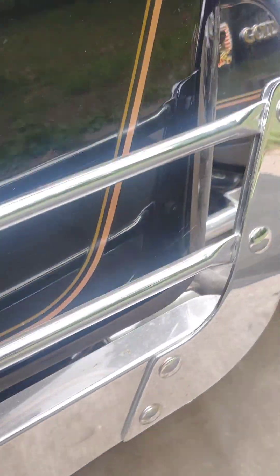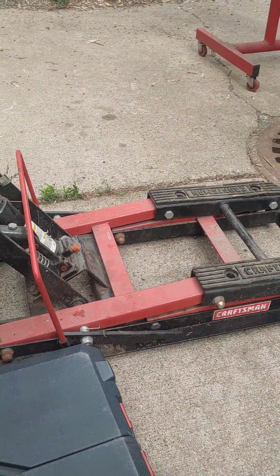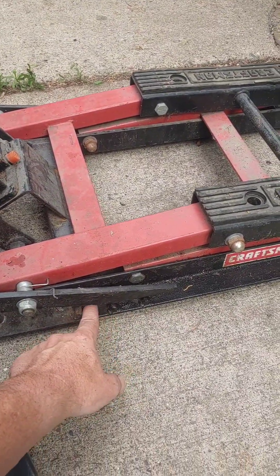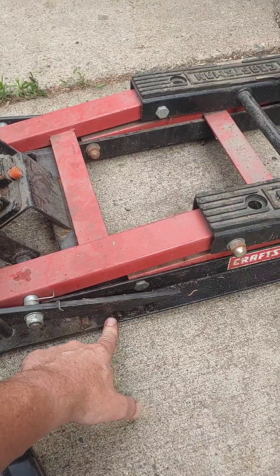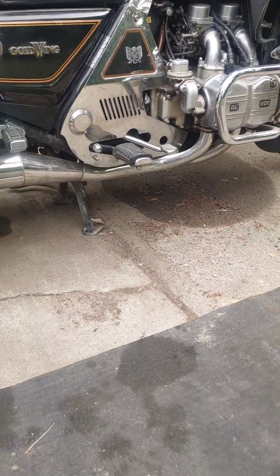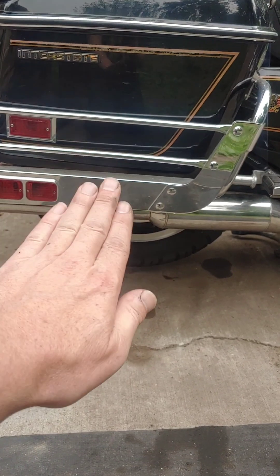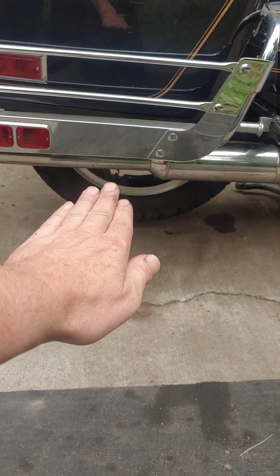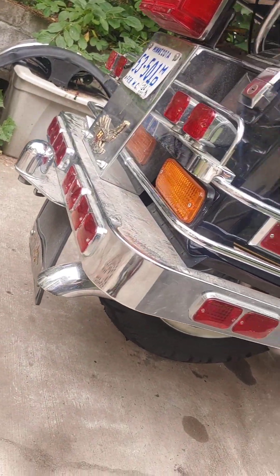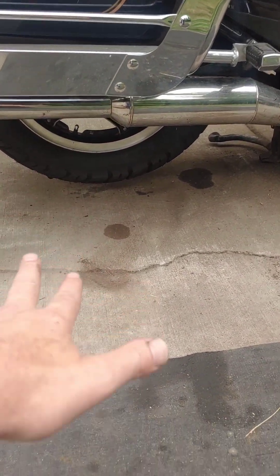The other key thing I should mention is that while the bike is down on its center stand now, when I was using this lift I had it jacked all the way up to the second notch. So you've got these safety notches — first safety notch, second safety notch — I had my Goldwing probably two feet in the air. That was the only way I could get this tire to clear, and I still had to flop it down sideways and then bring it out. It didn't roll out the back because we've got a bunch of fancy stuff back here. But if you do what I showed you for clearance and roll it down, it'll come out this way.